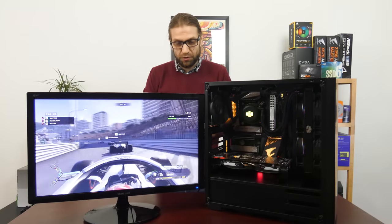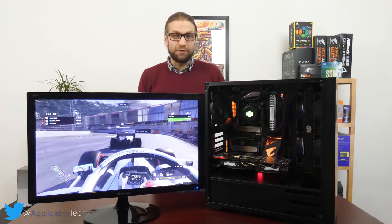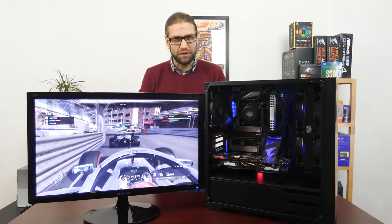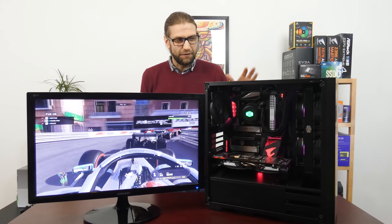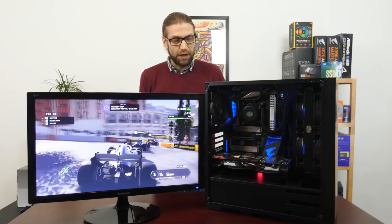I've actually tested the Asrock one off camera and that's working just fine with another processor, so it's definitely come down to that. So I've had to settle with all sorts. Oh, by the way, the M.2 drives, only one of them works as well. That was definitely an indicator that it was the I/O controller of the processor. So this is where we're at.